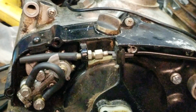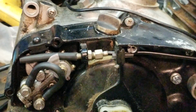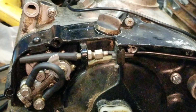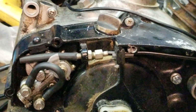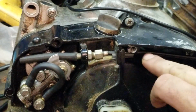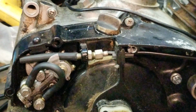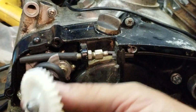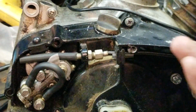And I hope you found this video informative, and I hope you guys follow it, because if you don't do it this way, I can't see your bike not having issues down the road. You know what I mean? Whether it be water and dirt, whether it be a lean condition, or a broken plastic drive gear. I mean, if you want to take the plastic drive gear out, you can do that, surely, but you have to split the case, and it really doesn't seem like it'd be worth all that work.